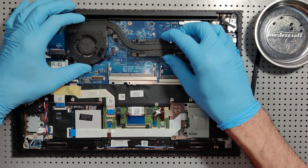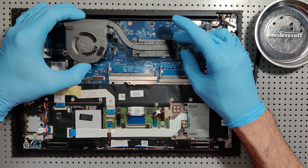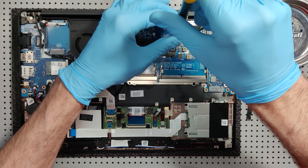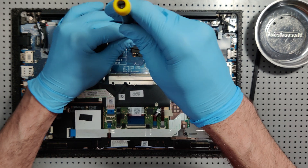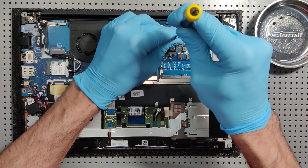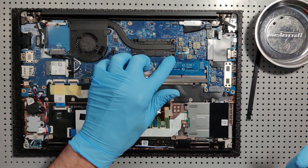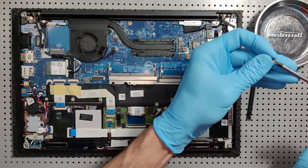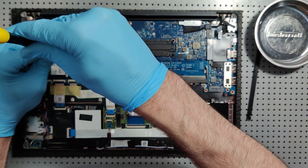I'm going to look where the actual screw holes themselves are, then go in a diagonal motion — just as tight as you can get them to the point where it doesn't want to go anymore, but not pushing hard enough that you're going to shave the rivets on these screws. Then reattach the heat sink fan and reconnect the power.